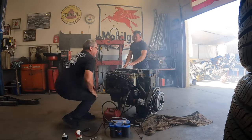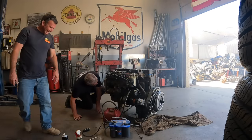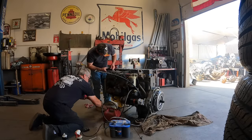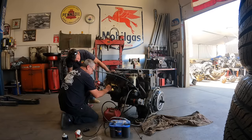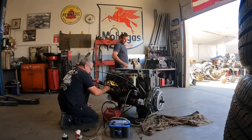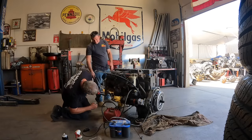Got a really bad oil leak over here. Make it idle and then pin it all the way around. Got the oil leak right there. Great — it runs! We didn't catch on fire. Yet. I don't know where all that oil is coming from, but one of them is leaking — looks loose, yeah it's loose. Sounded pretty good — it was running on all six, it was fired. Smoke cleaned up after about a nanosecond. It's been sitting so long the injectors were all stuck on it. It'll start right up now.